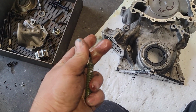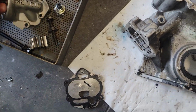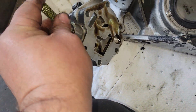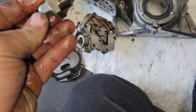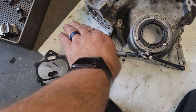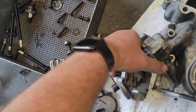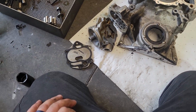This is the pressure relief valve. The pressure relief valve goes in here, like so. It controls the cracking pressure of that valve, generally a 60 psi spring. So you can tweak it. Does it affect the curve through the engine? I don't know. Probably does. Much like a line pressure spring in a transmission, it probably does.